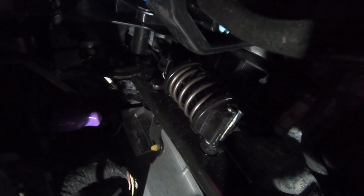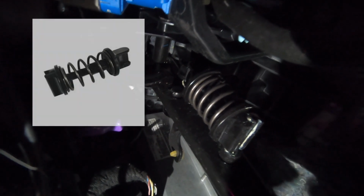So a quick bonus for y'all. There is this clutch spring that is on every stick car, and the stock one is 185 pounds. It assists you in pushing the clutch, and that kind of takes feel away from the clutch. So if you switch to this one, like this one from Steeda, which is a 35 pound spring, and their perch, which is Delrin, is way stronger than the stock perch, you'll have much better clutch feel. It won't necessarily help with your MT82 issues, but it'll definitely make the clutch pedal feel a lot better. And you use the clutch every time you shift gear, so better clutch feel, better shifting in general, but it won't necessarily fix the problems. But this is a nice additional piece to put on. I highly recommend it. It's not too expensive compared to other mods on the list, and it'll definitely improve the feeling of your shifting. We'll pop a picture on the screen if I find the old one, but the stock one is really just a lot thicker and a lot worse to use.